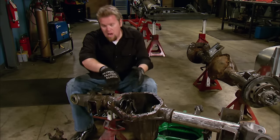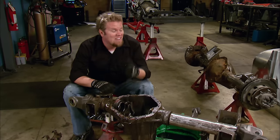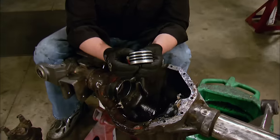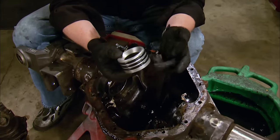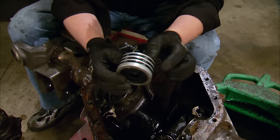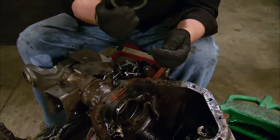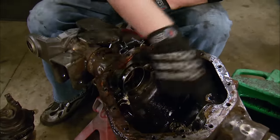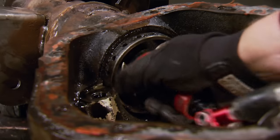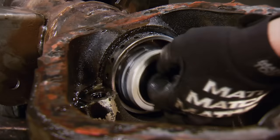So we did some research, called around, and found a company called Seals It. Seals It specializes in seals for almost any rotating assembly you can think of — everything from big heavy-duty industrial stuff right down to axles themselves. We gave them measurements like the inside diameter of our tube as well as the size of the shaft going through the seal. Now we have a specific seal for our 14-bolt that we'll put right inside the tube to keep the fluid in the diff. The first step is to simply clean up the inside of the axle tube — not polished, just get rid of any welding slag or burrs from the factory. Then we'll lube up the O-rings on the seal and pop it into place.